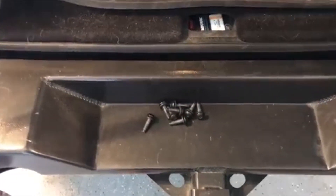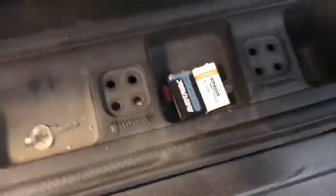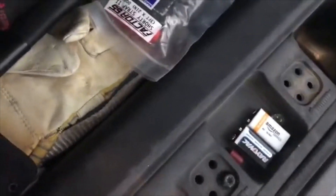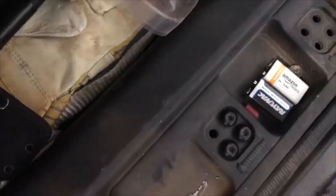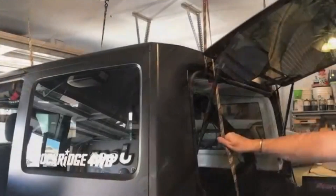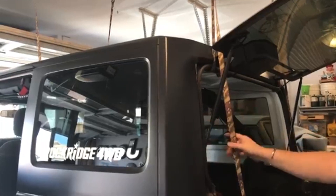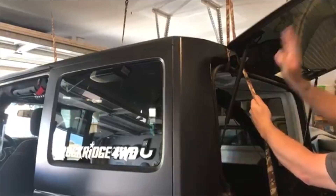We've got all eight top bolts off. Here's a little secret tip you may not know: in your rear storage section, there are actually spots for all the bolts to go. Just pop them all in there and they're stored safely away from being lost or damaged. All bolts removed from the top, and power and liquid are disconnected inside. Now it's just a question of putting tension on the straps and pushing up on the window to get it loosened up.